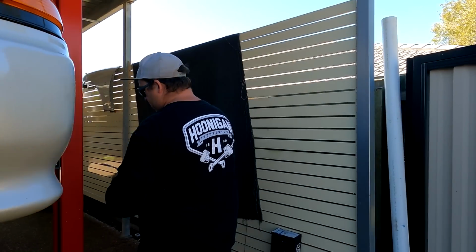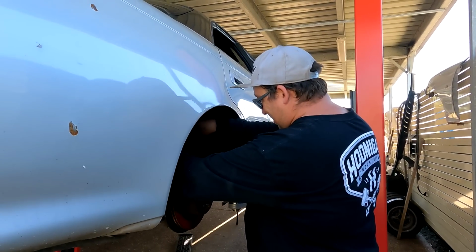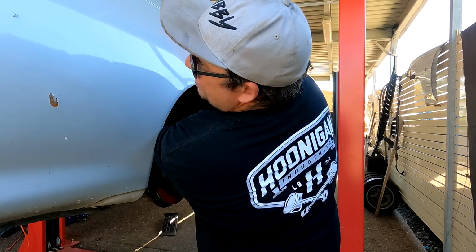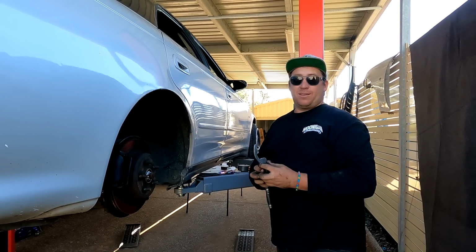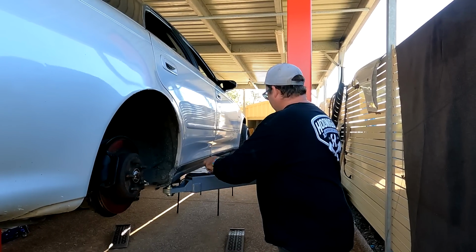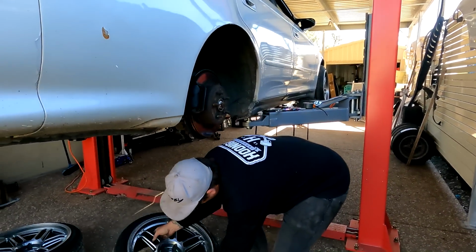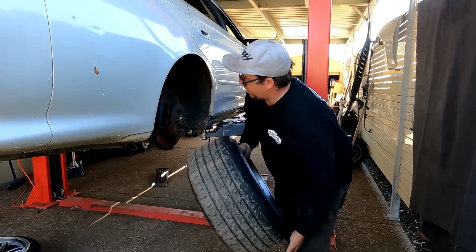Overall, just literally raising the car to make it, like I said, more legal, more drivable, a bit less camber. It had way too much camber on the rear of this car. Can never have enough camber. It was basically to get wheels that fit. These wheels have too much offset and stick too far out the guards.